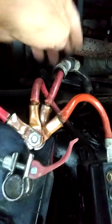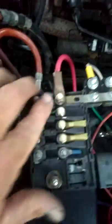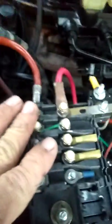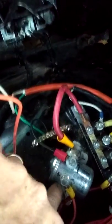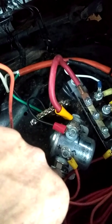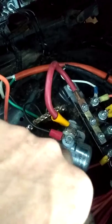This one here is going down to the starter motor, and this is the hot wire that's coming into the block for all the electronics on the vehicle — accessories. It just jumps across right here. This is the main hotline. It goes down, comes into the solenoid on the input side, which is going to be your plus. On the other side of the solenoid is your output — when the solenoid is activated, the power comes out and goes into this electrical circuit here that has inline trip fuses.